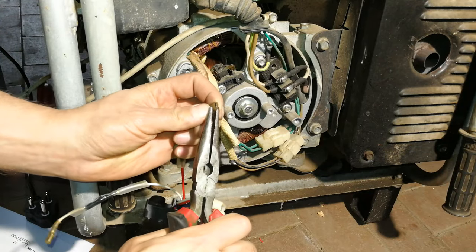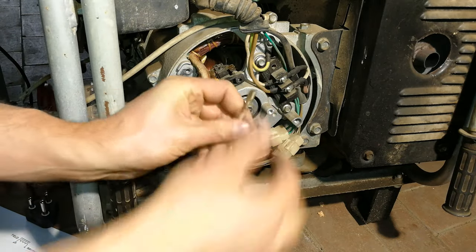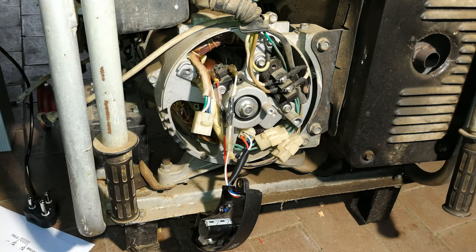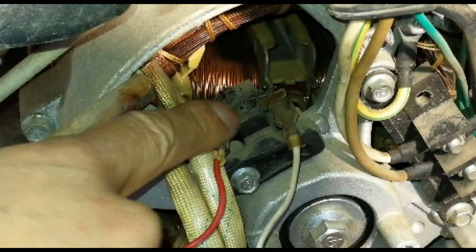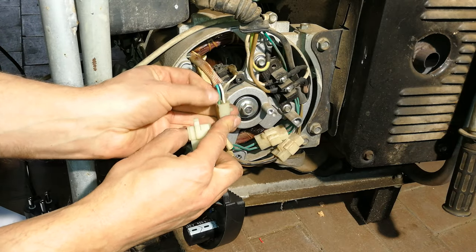You can tighten these a little bit — they've gotten loose over time. If you want, you can even file them a bit just to clean them. The polarity of these terminals is quite important. If you look closely on mine, there's a little sign indicating negative — so the white is on the negative and the red is on the positive. Make sure you get the polarity correct. In terms of these wires, I've put the blue-blue matching to the blue-blue, and there is the green and white.